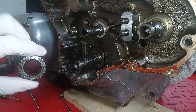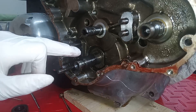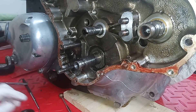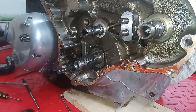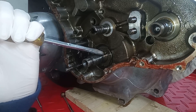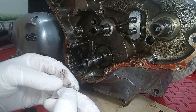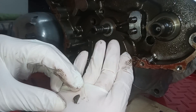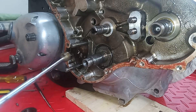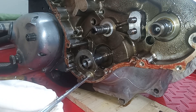The pinion has finally come off. There's a woodruff key that the pinion sits on — we persuaded that to come out, though it will obviously need a new woodruff key as it was damaged getting it out. That should allow us to get rid of that horrible three-sided spacer.